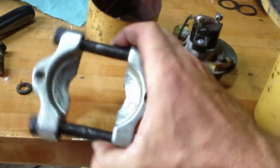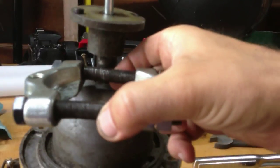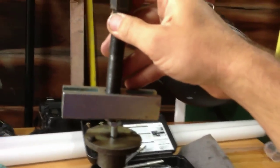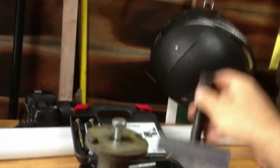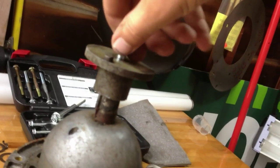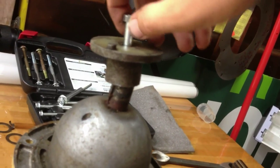So I got this little doohickey, rented this from the hardware store, put this on around under that hub there, and then used a puller to go on the top to push down on a 5/16ths bolt right down the middle to pull this hub up, and lo and behold, it actually worked. I guess PB Blastering it every day for the last week was a good thing.